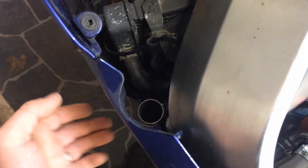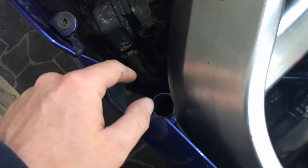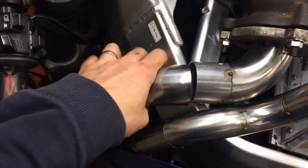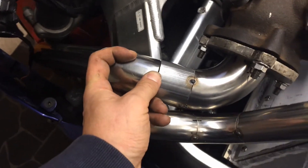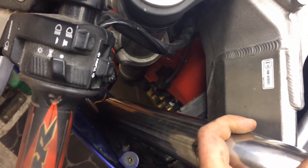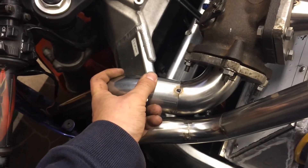The fairing modification is finished so the pipe can go up there. I'm going to put some insulation in there to protect the fairing and a foam metal plate to keep some strength in it. The exhaust routing is taking some working out — I need to make sure the forks can still swing inside the clearance, that when the wheel compresses the exhaust doesn't get hit, that it clears all the wheel and brakes, and that the handlebar misses the exhaust and the tank still fits. But we're getting there.